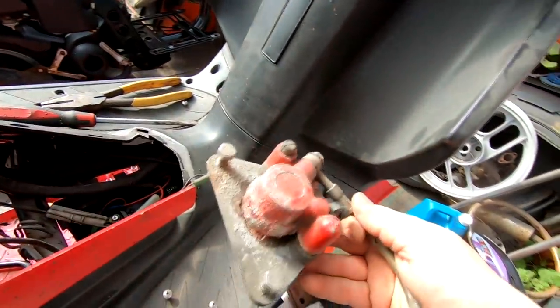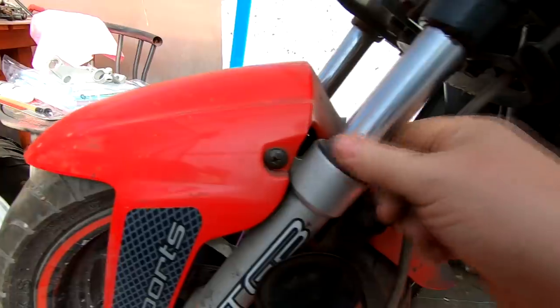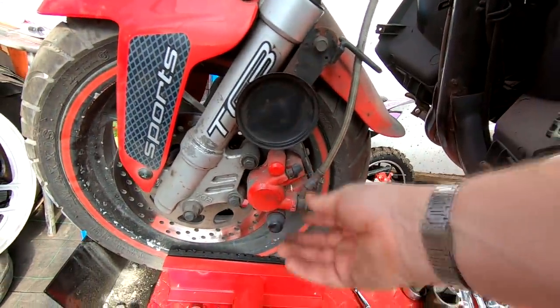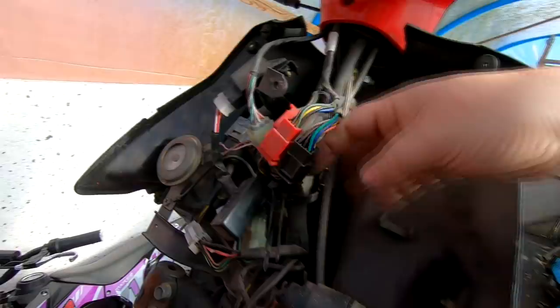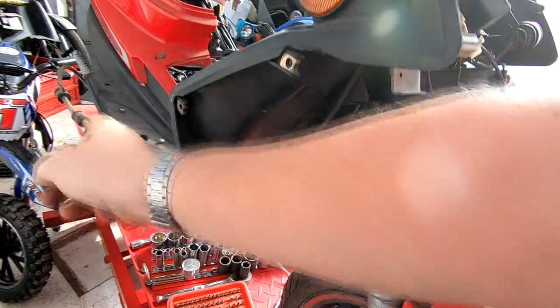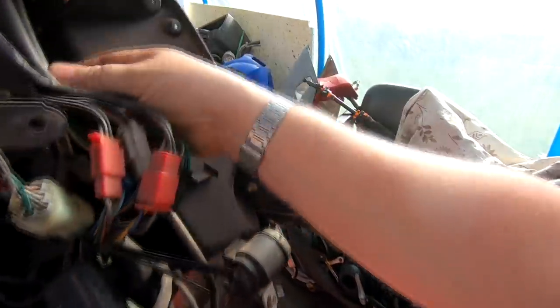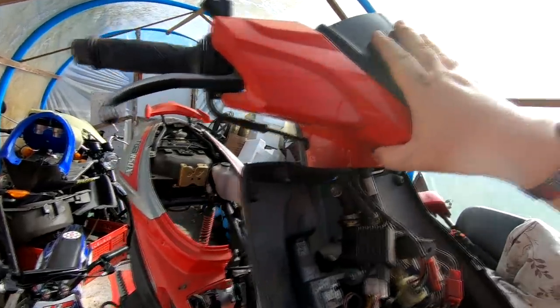Right, so I'm going to take these brake calipers off now — just going to unbolt them, front and back. This one obviously needs to come off; the forks are in good condition so I won't be touching them. Now I'm just wondering where the master cylinder is for this — it might be behind this fairing up here somewhere. The one for the back also comes down the front and they both go up into the head unit. There's a Goodridge hose someone's put on there and they both come up here into this head unit, so I'll probably have to take this nose cone fairing off — I can't actually see it initially, so I'm going to do that now.